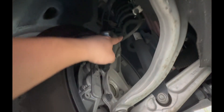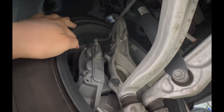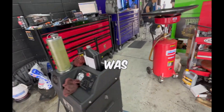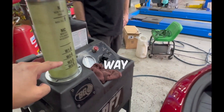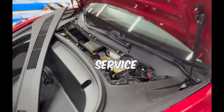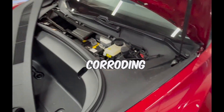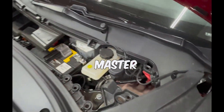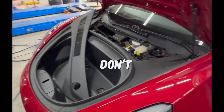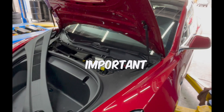We close the bleeder screw here. Sometimes you have to take the wheel off for clearance to access it. This reservoir is now empty — it was full of new fluid that has all traveled through the system, and the fluid inside is definitely a lighter color now. That's a complete Tesla brake fluid service. This keeps the expensive internals from corroding — the rubber seals in the master cylinder and the rubber hoses will collapse and corrode without it. Don't overlook this service, especially if you're in a colder climate.